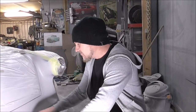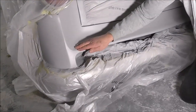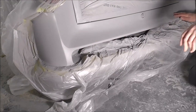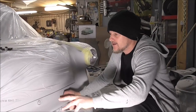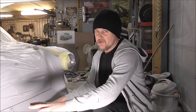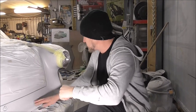At the back we always had this recess but I've brought this lip out so it's flush all the way across on both sides, and I've made this swoop a little bit lazier. The swoop sort of comes up leaving this sort of triangle shape here - this still needs quite a bit of work. But as always, this has been sanded in 40 grit. When I shape filler, anything like that, it's always just in 40 grit. I've never touched the filler with anything else - maybe a bit of 120 if I'm going to feather some out, but 95% of the time just 40 grit.